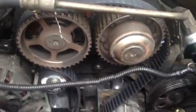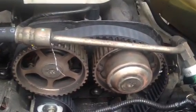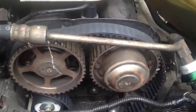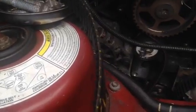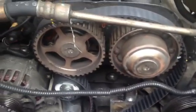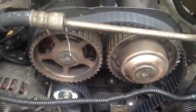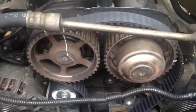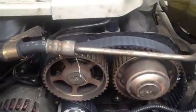This is also the way to do it with VVT gears, because the gear can actually move on you internally around the cam if it doesn't lock when it shuts off — you can get into a real nightmare and destroy your motor. This is the way I've been doing it for years and I thought I'd put it on YouTube to help some people out. I know they get frustrated with mechanics charging so much money. This job is a $750 job on the low end, probably $900 on the high end, because it requires special tools. Hope this helps — leave any questions or comments below.